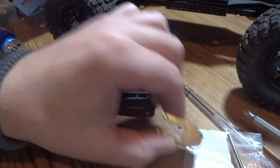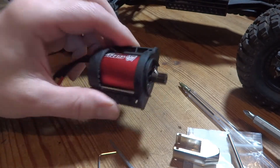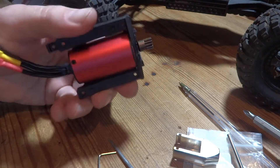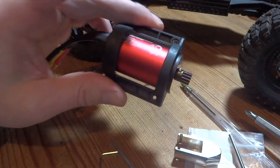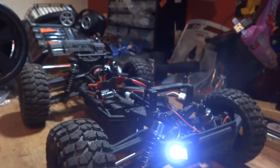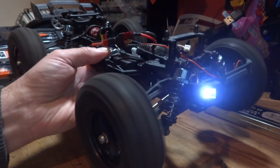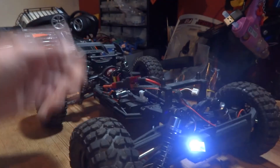That's the new motor back in the plastic carrier — what a palaver that was! Thank god I bought this little pinion gear puller; I'll put a link in the description — it's worth its weight in gold. I've loctited the motor into the plastic carrier and loctited the new pinion onto the shaft, just waiting for that to go off. I'm going to try it, and if successful I'll reinstate some sort of radiator to help keep it cool, since I can't use the original as they bond them onto the motor. The motor's back in, all I've got to do is put the little gear cover on. Let's give it a quick test — it does feel a bit quicker! Let's go and try it.